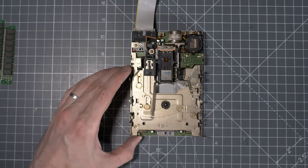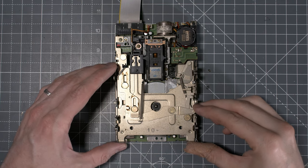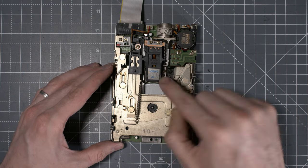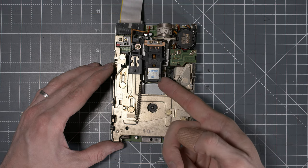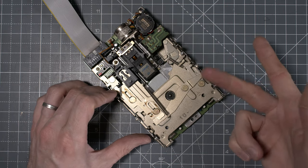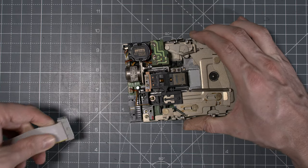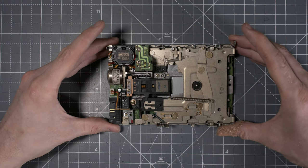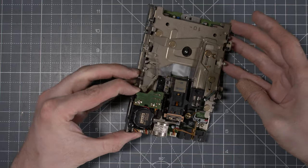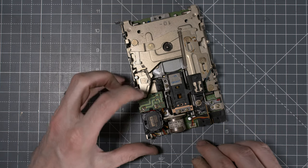Let's focus on this floppy drive. Adrian from Adrian's Digital Basement has an awesome video about how to restore those floppy drives from those old Macs, right? Those Sony branded ones. So you see there is the head there and a screw to actually move it from track to track. It's really dirty. If you look carefully, you see that here there is the track zero detector. So that's something else you need to take care about. You need to be sure that it's cleaned up.